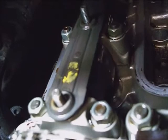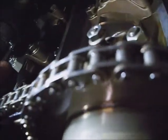To the tool — to hold them as a backup so you can tighten these bolts in the front. Cover your spark plug holes up; you don't want to drop any of these little 10mm nuts down into the cylinder. I marked an E with an arrow pointing forward on the exhaust oil rail, and an I pointing forward on this rail — that'll identify it as up and forward, and which bank it goes on, which camshaft.